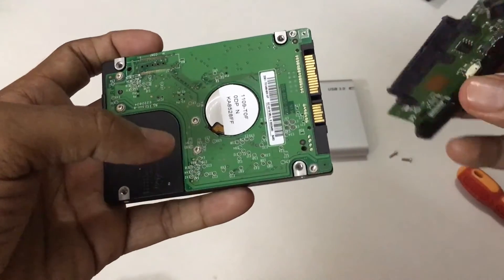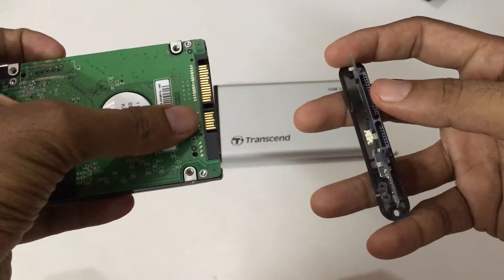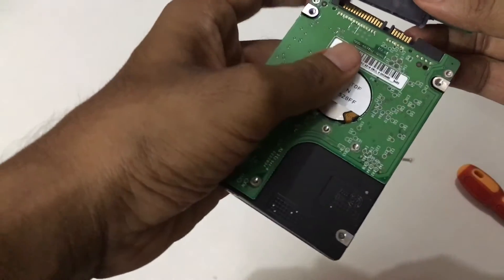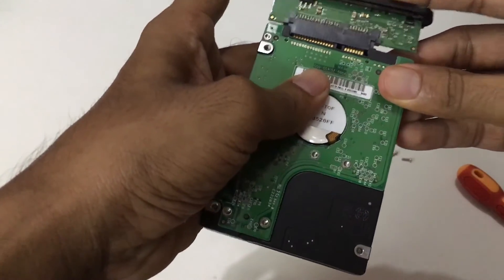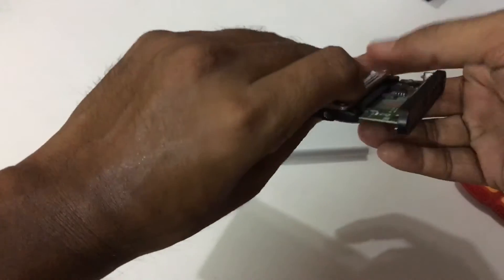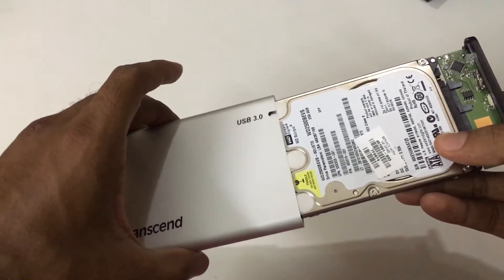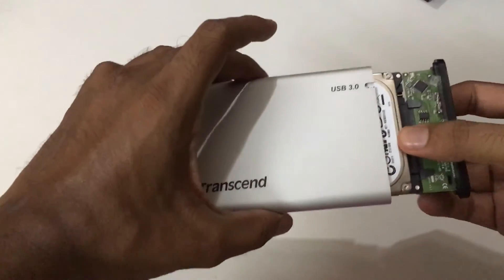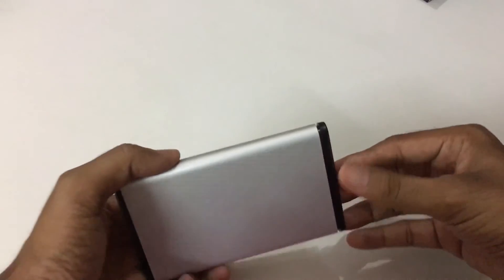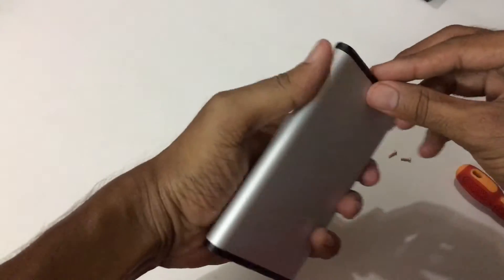Pick your laptop hard disk. As you can see there is a small pin and a big pin, and similarly there is a small and big connector. Carefully connect both — be careful when inserting the hard disk into the connector. Ensure it is properly fixed on all ends, then with the sticker facing out, put the hard disk inside the casing. Push it in gently, then do a slight gentle press on top.